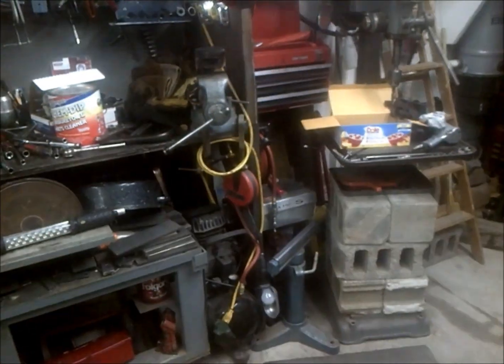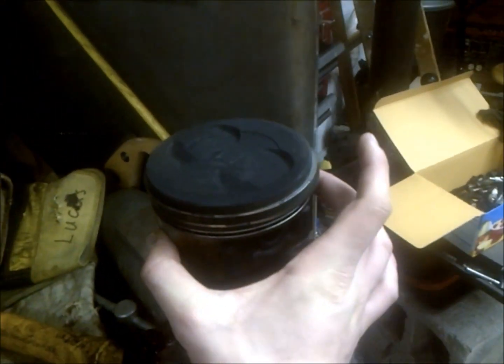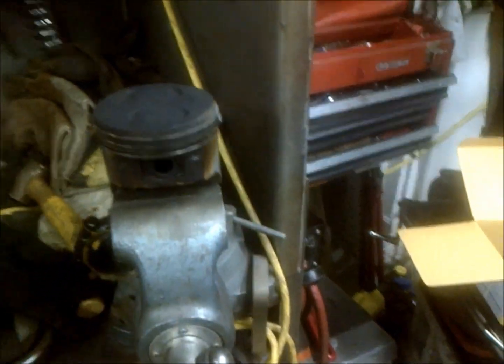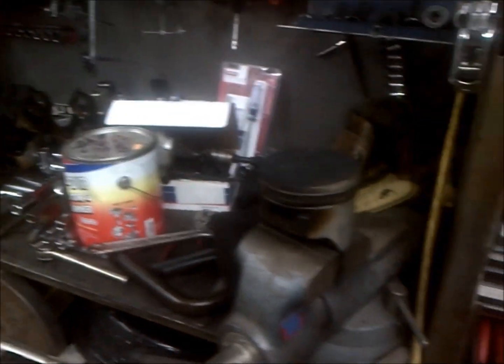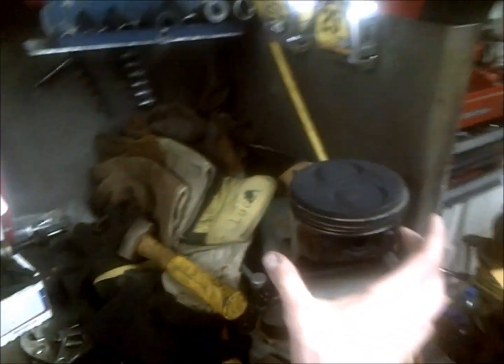With these standard pistons they all still come out to be within the 4-inch bore — they don't show anywhere outside of spec. So what I could do is hone this motor out, re-ring these pistons, put in new bearings, and reinstall them and it will run just fine.